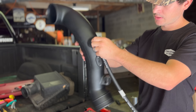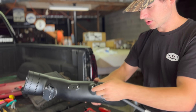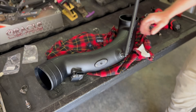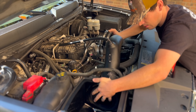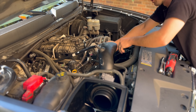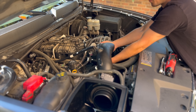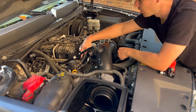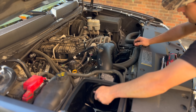This is a 14mm — you don't want to go crazy tight with it and break it, so we're just going to snug it up. That should be good just like that. Let's go ahead and slide our intake tube into the air box and then put it on our throttle body, just like that. Everything's nice and loose. We do have to probably cut this hose and then it's got to snake down and go over that metal pipe, and then we'll put our two clamps on it.